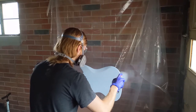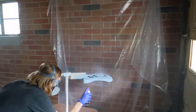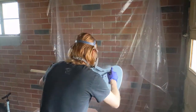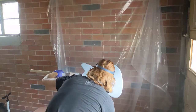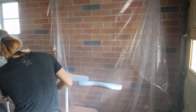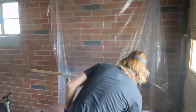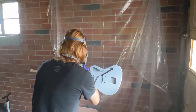I'm going to fast forward to the third coat where something happened. I actually had a can that started spitting, and when that occurred I noticed it — you'll see a gap where I quit spraying and switch out to a new can. It spat some gobs of paint onto the body, kind of a rough surface you don't want. You do have to watch out for that. I probably should have been shaking the cans more and clearing the lines more often, but it's really not that bad because you can sand it out. It's actually pretty forgiving — even a run can be sanded out if you're careful. It wound up taking about two and a half cans of primer to fully coat the surface, partly because I was going fairly thick trying to bury some of the wood grain.